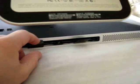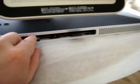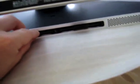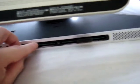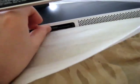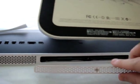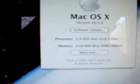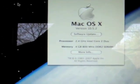Of course, you're going to want to replace those ribbons back into their normal positions — that only takes a second. Go ahead and do it on the other side too. As far as upgrading your RAM, you're done besides replacing the plate. Put the plate on, screw it back in, and make sure both sides are flush. Go ahead and start your Mac up, hit 'About This Mac,' and you can see it says 4GB of upgraded memory.